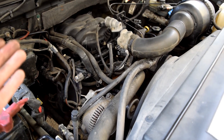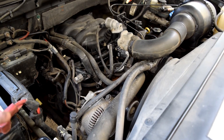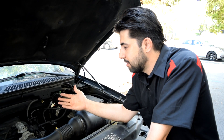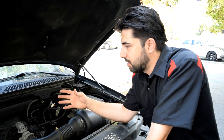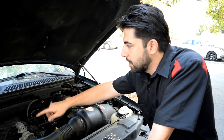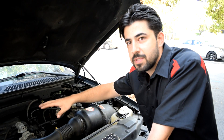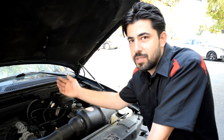Diagnosing EGR issues could get complicated depending on your car's make and model, and I'll put a link to a video I did a long time ago at the end of this video. Unfortunately we're not going to get to do this repair because this car is being sold at auction in the next few days. But if I were to do this repair, I would check the EGR, PCV, and vacuum lines, then remove the upper intake manifold, further inspect the vacuum lines in the back, and then proceed to replace the upper and lower intake manifolds and maybe even clean the fuel injectors while we're at it.